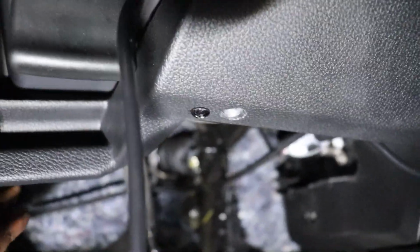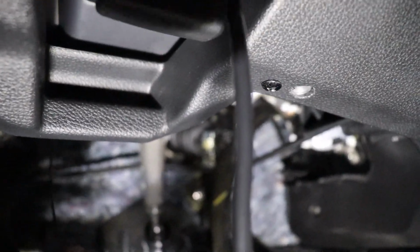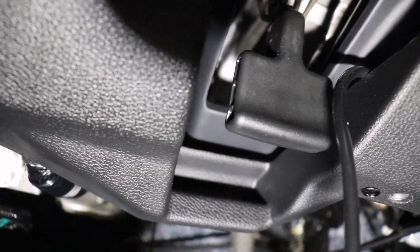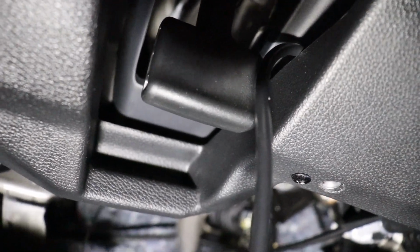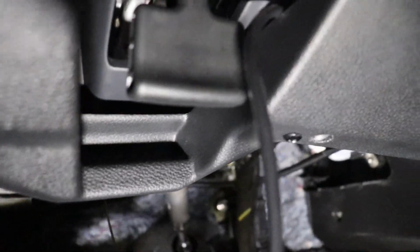Okay guys, so Nick just passed me the harness. You've got to be real careful when you do this, because before I grabbed this, he had already kind of over-pushed it and it was inside my plastic over here. You don't want that. You want the harness to come right down the bottom over here, as you guys can see, just a straight shot down, and that's where you want to pass your wires through. Those wires behind over there are for my ambient lighting and the Type R door seal trim. I routed them behind each one of the pedals, so that's why those are like that. Same idea for this, just wire them across and put it inside to the side over there. But yeah, it is here now. Nick just has to connect the wires on and then pass them down.